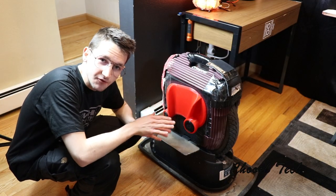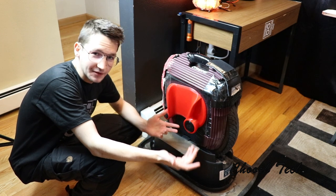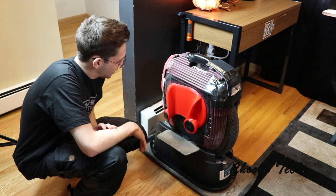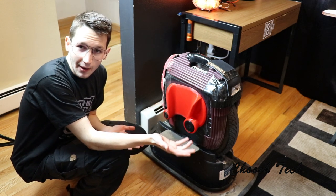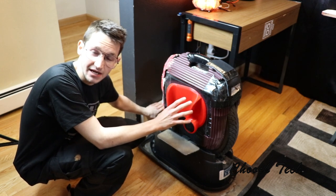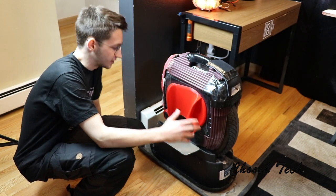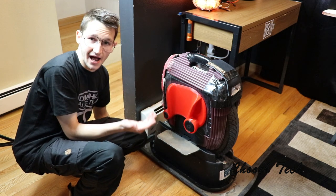This right here is going to save all of you who ride in snowy, muddy, wet, rainy conditions. These electric unicycles are incredible in the snow — the IP rating on them is fantastic. You come back and they do pick up a lot of snow. The best thing you can do is have the wheel completely vertical when you come back, in a warm place. I have it right over here by the baseboard heaters — not a lot of direct heat, but it'll melt the snow and keep everything dry. A fan is even better.